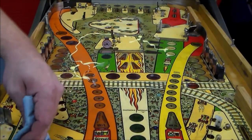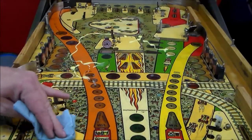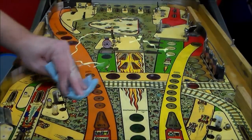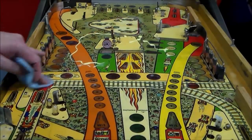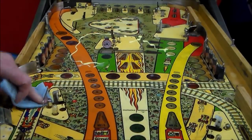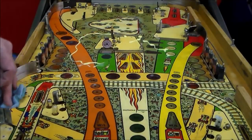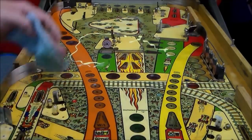And we like the wax, you know, if you're touching up a playfield, you're just doing the areas that the ball travels. But on this one, since we've redone everything, we've even got new paint on parts of it, we're trying to get wax on every single part of the playfield. Whereas on a newer game, or one that started out in better condition, the wax presumably would already be on all of the areas that the ball doesn't touch.